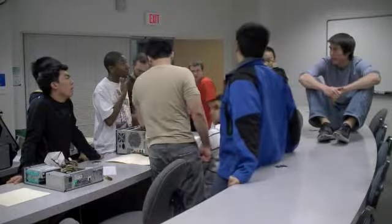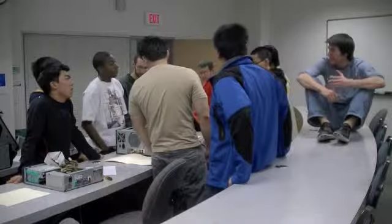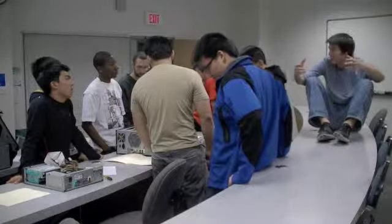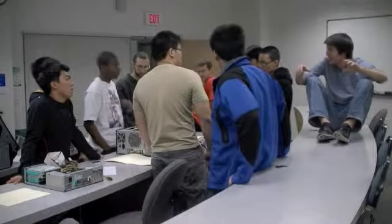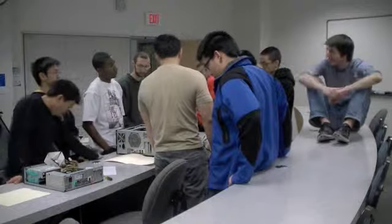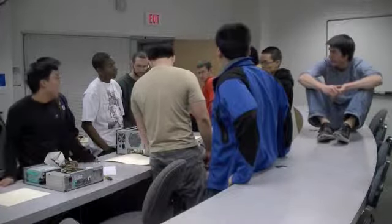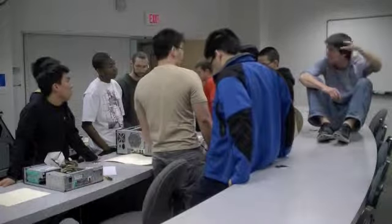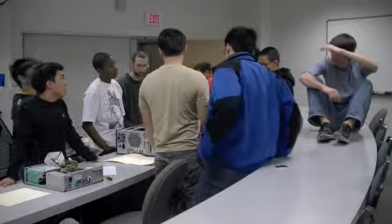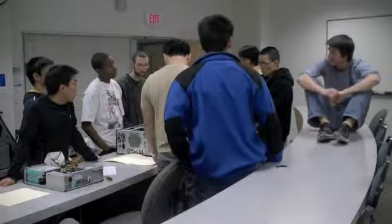It's a bottleneck problem. A bottleneck refers to a constraint on the system. If you have two components that are really high functioning and then one component that serves as an intermediary, that's going to be a bottleneck. It's going to slow everything else down. So the FSB speed advertised on your motherboard, the front side bus, acts as an intermediary between your processor and the memory and the other components. So you want to make sure that those match up generally.